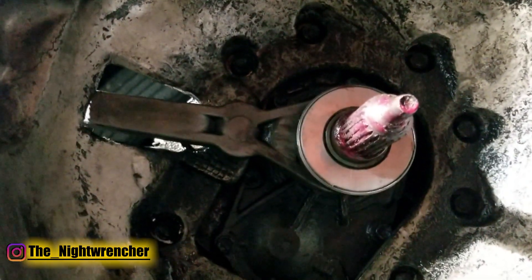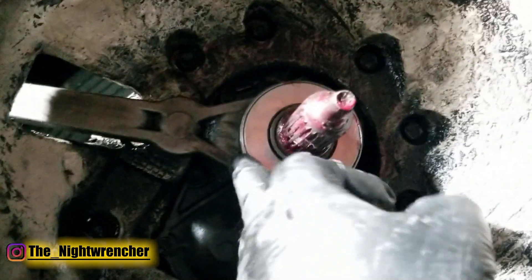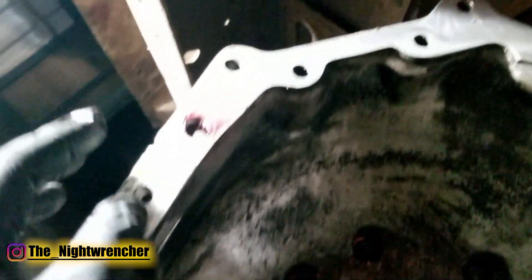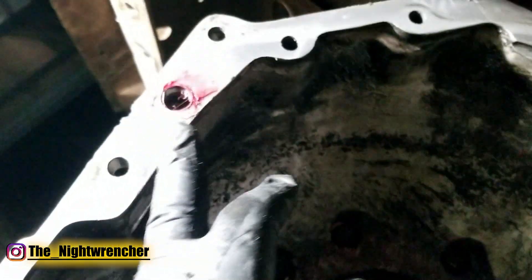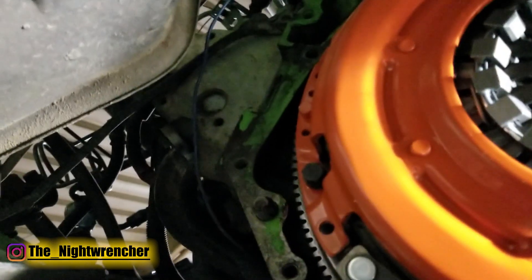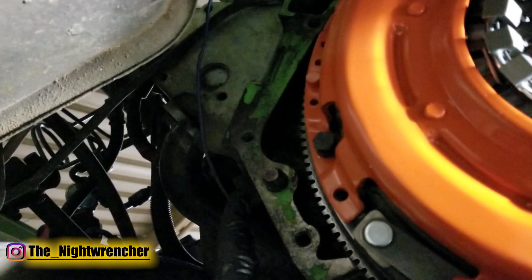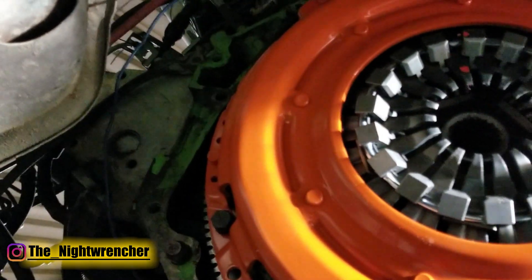I'm under the truck again and I've got everything already lubed up and installed. I've got the shift fork here, the pivot point has already been greased up, and the throwout bearing is all good to go as well. Another tip: lube up the two little holes that align the transmission and the engine. These two alignment dowels are going to try to hang themselves up when you're trying to install the transmission, so if you have a little bit of grease there that should help. On an LS you have one here and one on the other side — lube them up on the engine side and against the transmission.